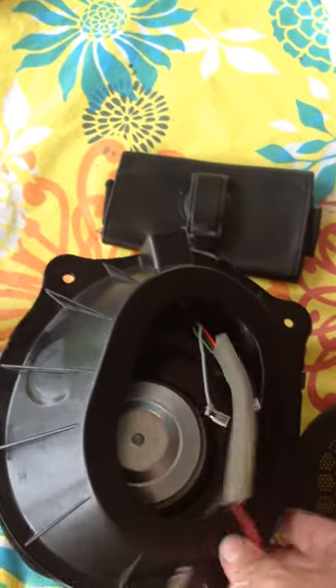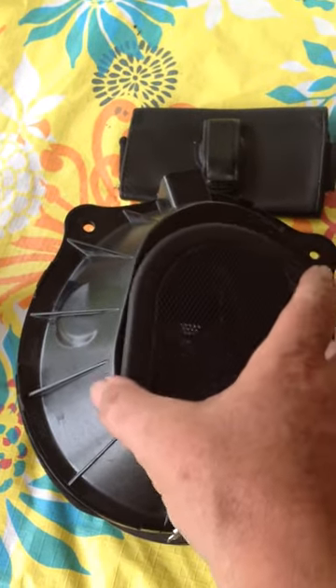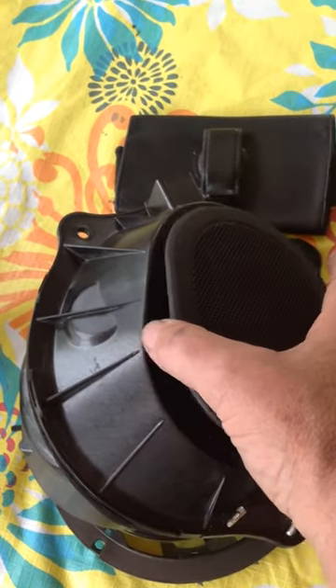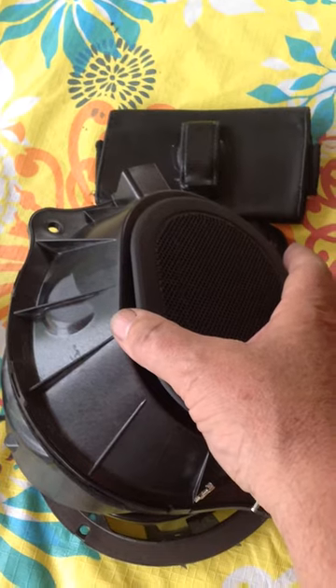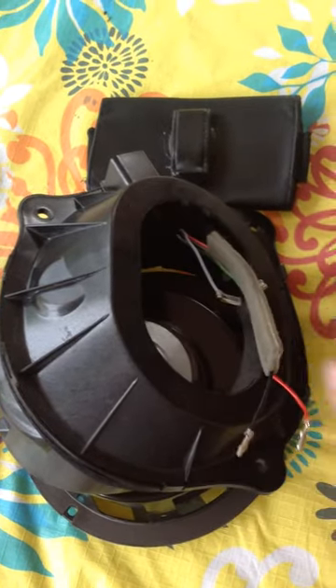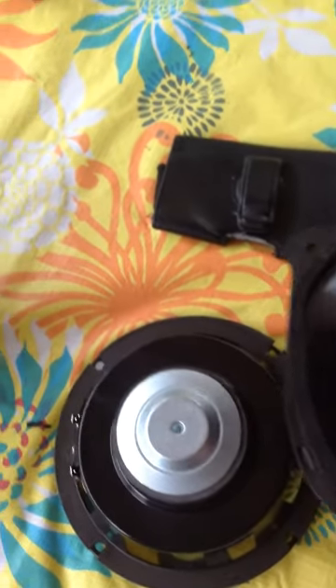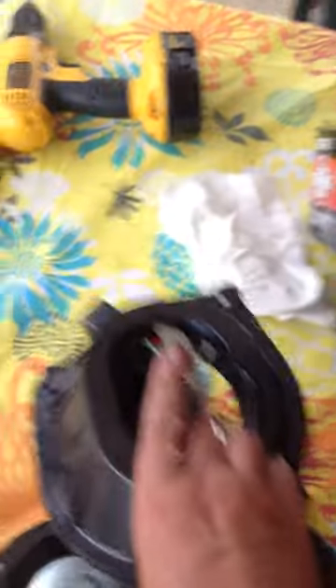One of the things you'll see is that the speakers are mounted backwards in the driving compartment, facing the trunk. That acts as a subwoofer chamber — a little area between the back bulkhead of the driving compartment and the trunk area. This clips into a plastic frame — the shell that the speaker fits in — held by four T20 torx screws. The frame comes apart into two pieces, and here's your wiring harness that unclips. The car harness fits right in there.